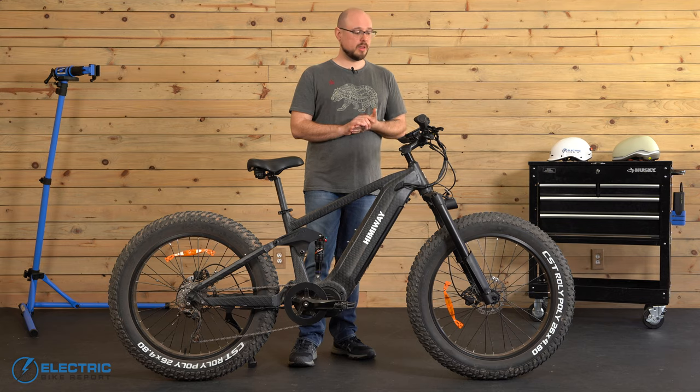We chalk up the Cobra Pro's performance in this test mostly to its weight. You can see how big the bike looks in front of me, and it makes sense that this weighs almost 90 pounds. This isn't uncommon to see in the world of e-bikes, but it is towards the heavier end of the spectrum, and it does mean that those brakes have to work a little harder to slow the bike down once it's up to speed. For this reason, we'd really like to see Himiway upgrade these to 204mm rotors in the future. Larger rotors would provide better modulation and heat disbursement for those tougher off-road conditions.